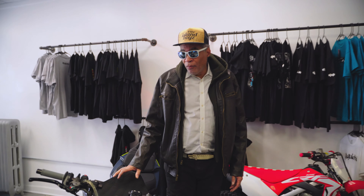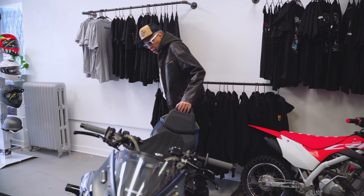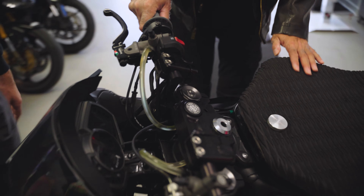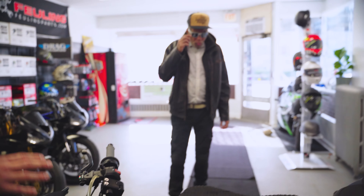Awesome. Just like that — I was thinking there was a key somewhere. I love the way that it sounds. So you got your Woodcraft — that's how you started it. All your controls are set up. Two Brembo RCSs, your stealth stick. This is a 19-millimeter Brembo RCS — that's the master. We'll always run a little bit bigger one up front to push a little bit more fluid. This is a 14-millimeter RCS Brembo. They're both mounted to your Cox 50-millimeter clip-ons with the Cox triple tree to hide, clean up, and strengthen your front end. Steel braided brake lines.